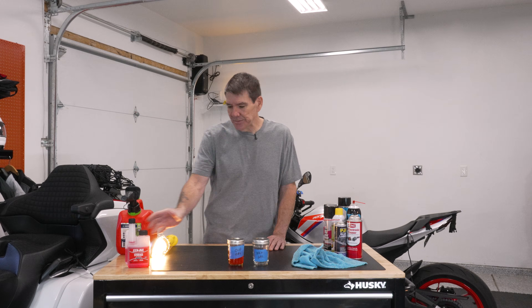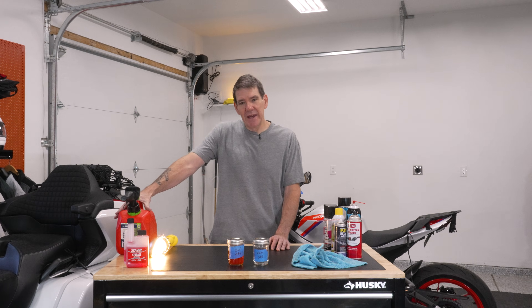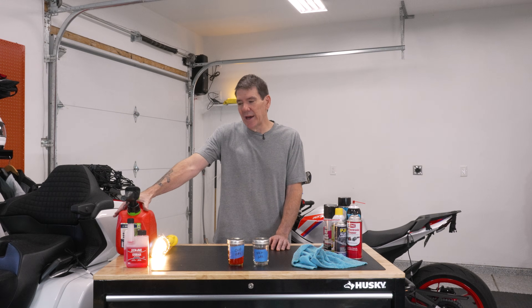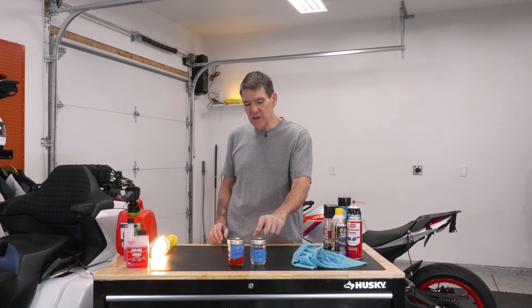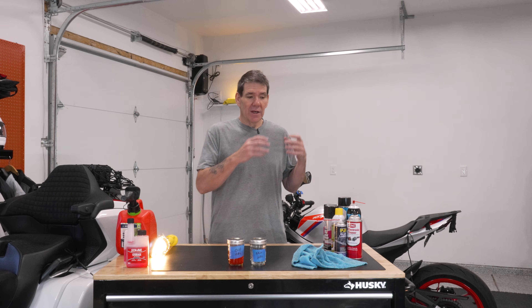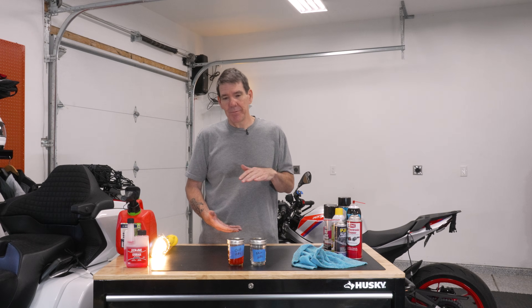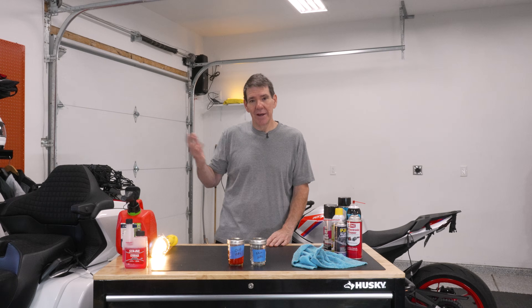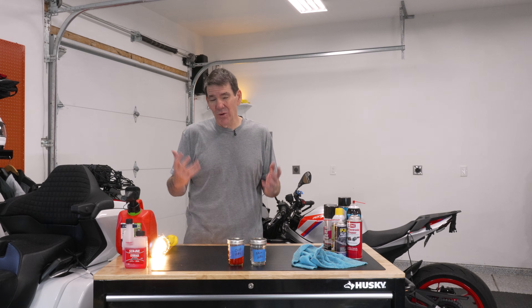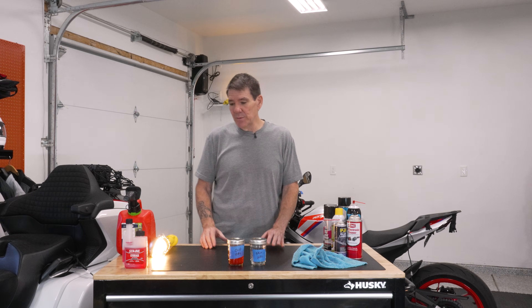It is really easy to protect against. You just need to get some stabilizer, put it in your gas in the right ratio, and run it. I also keep a can of gas over winter with stabilizer in it so I can keep it topped off. Here in Colorado, and a lot of places, they add ethanol to the fuel. When that ethanol is in your fuel, it has an extra molecule — hydrogen, carbon, and oxygen — which makes it hydrophilic, so it attracts a lot of water. Once the water gets in your fuel, when the temperature changes it can precipitate back out. You want to keep your gas stabilized and your tank topped off all winter long. Anytime I run my bike — every week or every couple of weeks — I'll ride, and then top it back off with stabilized gasoline. That's all you have to do to protect your gasoline.